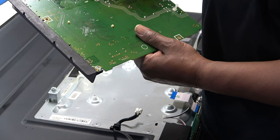Backlights came up. They are staying up, and look, when the backlights are up, it is at 135. Before, when the backlights came up with the Hisense logo, it went to 90 volts. All right, so now, okay, it does this little reboot thing. It does reboot once. Okay, that's natural. All right, and now the backlights are actually staying on. Okay, so we're at 140, holding steady.